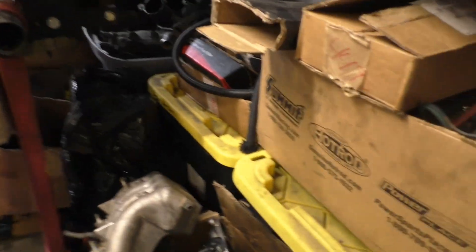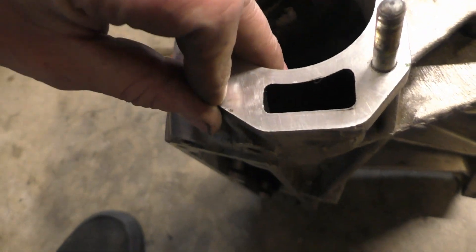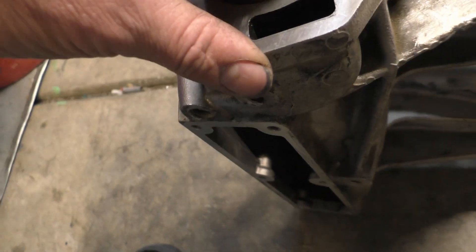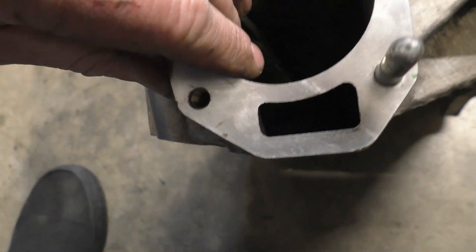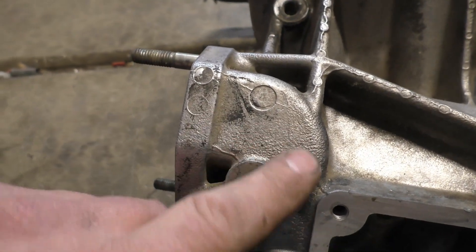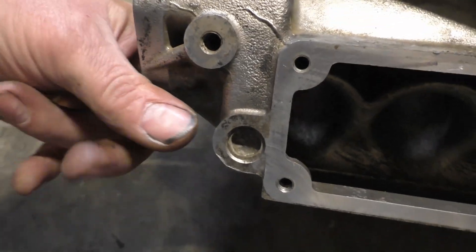Now, because I have this motor right here that I bought from somebody for super cheap, it came with the K20 intake. You can see on here — here it is on the factory Honda OEM one — it's nice and large, a lot of room for it to regulate the air. That's all an idle control valve is: it's just an air bleed screw, but electronic. On this one, you can see where the passageway is. It comes in here and then tapers down, and there's a hole inside the intake so that it can regulate the airflow.